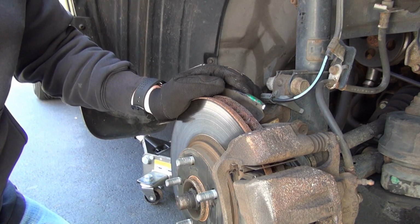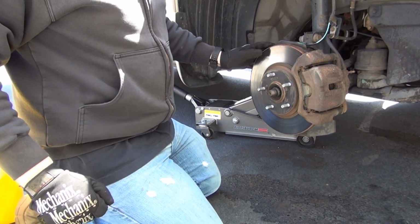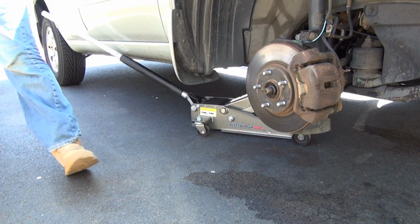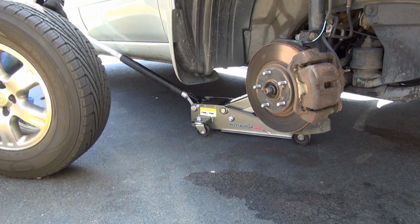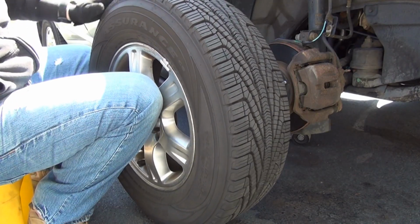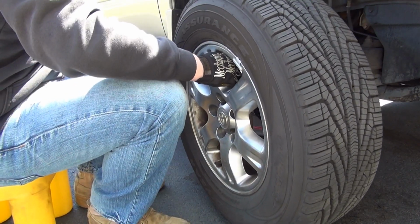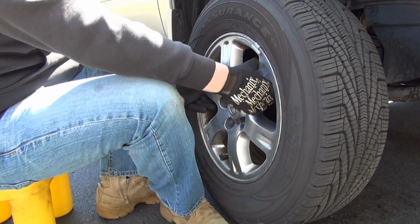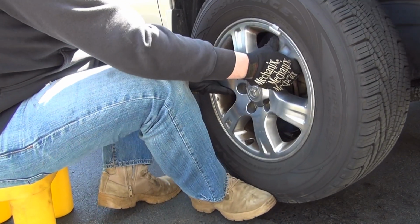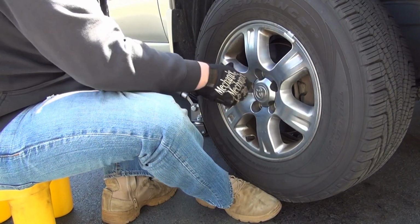Excellent. All right, our job here is done. Just put the wheel back on. Let me move the camera back and I'll show you again how to do that. Alrighty, guys. Let's get the wheel back in this area. Wheel your wheel back in. Move my mallet. Line up your studs with the holes in the rim. Look in. It's going to be flush with the rotor.